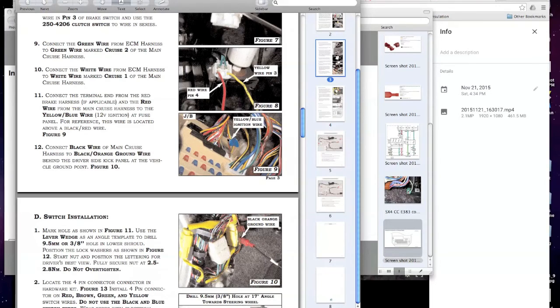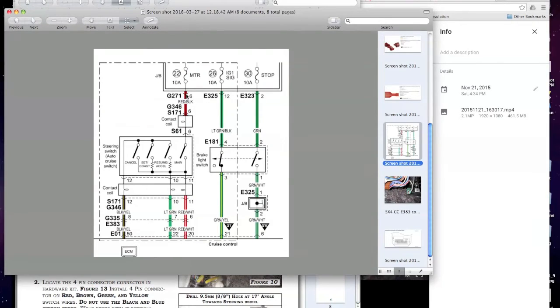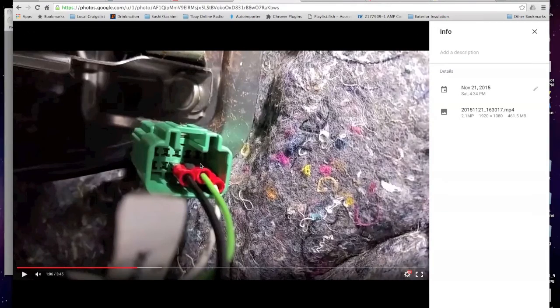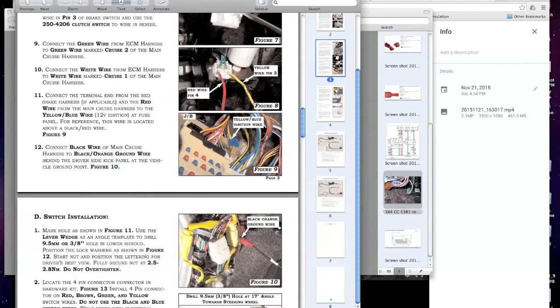And you see there's a red and black one here, and you're thinking maybe that's the MTR one, because in the wiring diagram it's red and black. Right, and they color code these for a reason. So red and black, and Rostra is showing you connecting to this blue one in their instructions. Now I don't want to do the blue one. I wanted to be on ignition 1. Accessory is radio and stuff, and I just felt like what happens is you're turning the cruise on, and then when you go to ignition 1, you actually turn everything off again, and then you turn it back on. So I wanted to be on ignition 1.